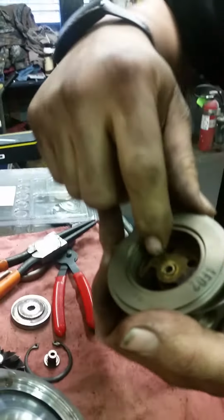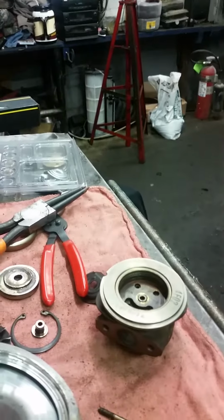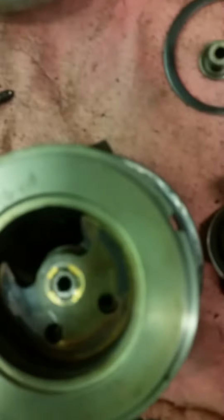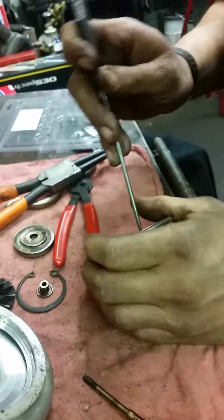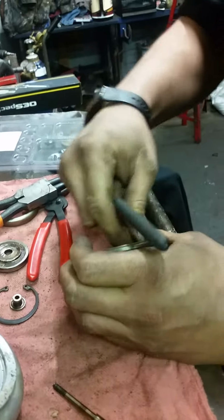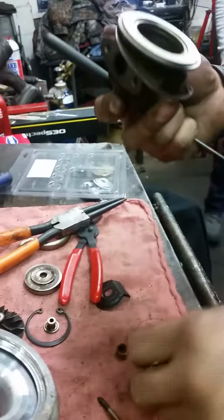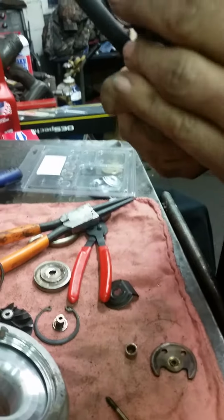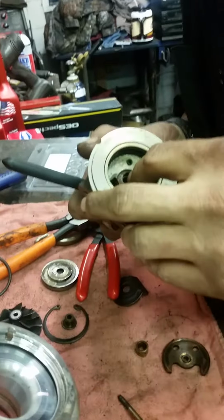Now down inside here is your rubber O-ring. So I'm gonna go grab a pick tool, because we're gonna replace that too. Oh, you did take the exhaust gasket. So then the thrust bearing falls right out of there. That collar gets changed, correct? Which one? That one right down in there. Nope, that's a retaining ring.